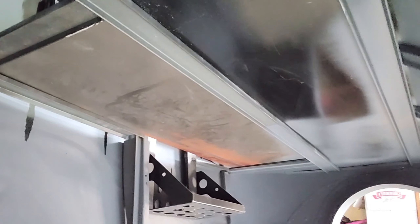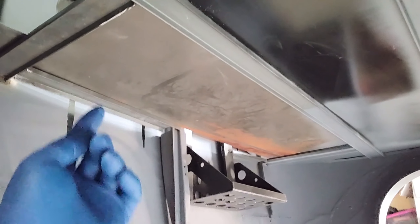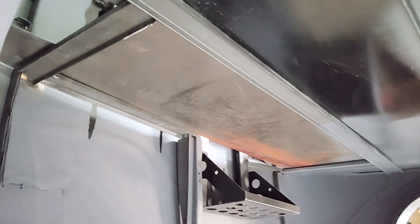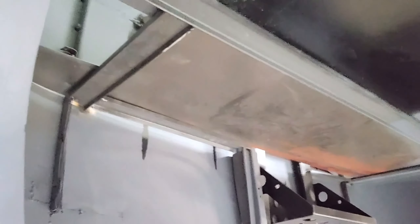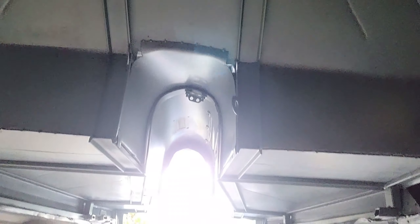More of the same kind of handiwork here. You might notice there's a panel that's not painted and it's got some rust on the back — that's actually removable, so I wasn't planning on painting that just yet because I'll be able to remove it and paint it properly. Another view here just looking down the transmission tunnel — you can see all the good handiwork. All of these seams everywhere where the C channel is, that's all going to get seam sealer. There's a little bit of a gap and some daylight between it, but not a big deal — that's where the primer got in as well, and we'll seal off everything in there.